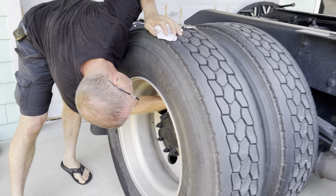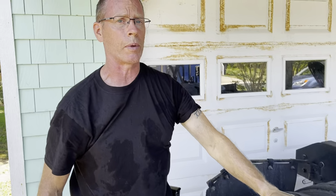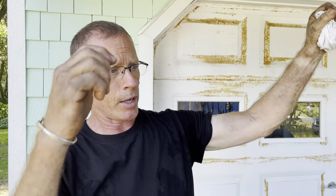Yes. Uh-huh. Okay. It's important because if your tires are low on pressure, they'll run hotter. It'll affect your fuel economy, which gets expensive. And if the tires are so underinflated that they start touching each other, these doubles, they will get really hot and catch fire. And if you're carrying a really heavy load on your fifth wheel, these tires are what supports it. You've got to have that air pressure to keep that load up, right? Yeah, definitely. All right, well, thanks for sharing that with us today, Kevin.